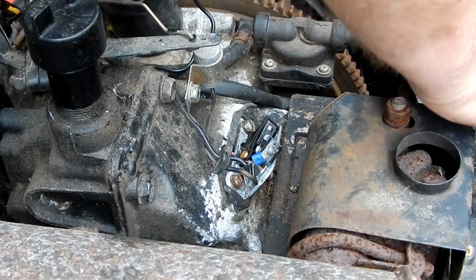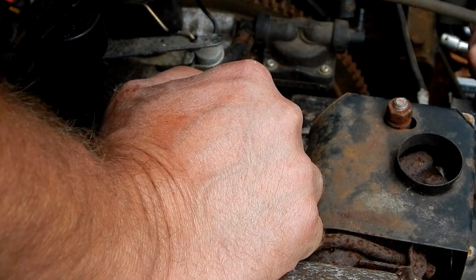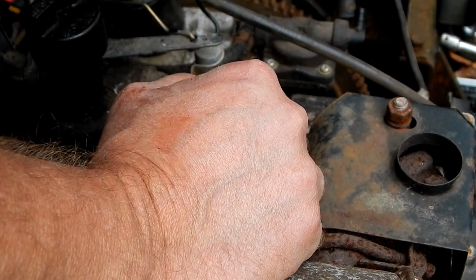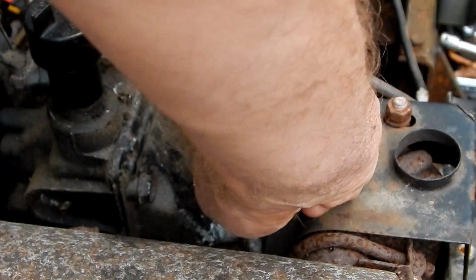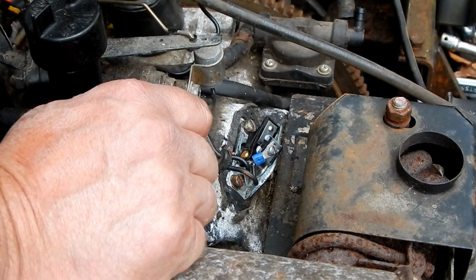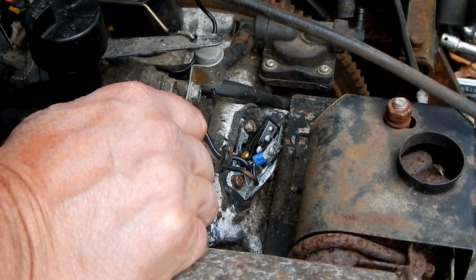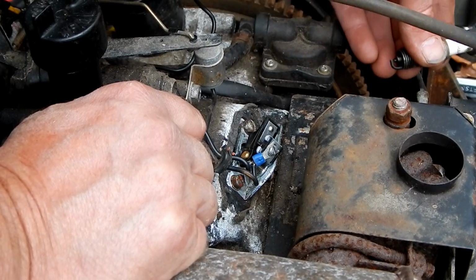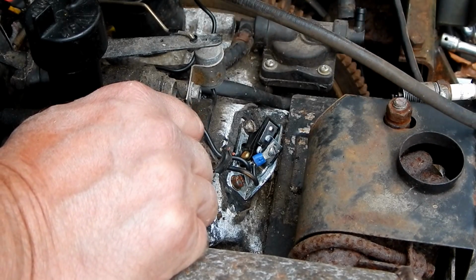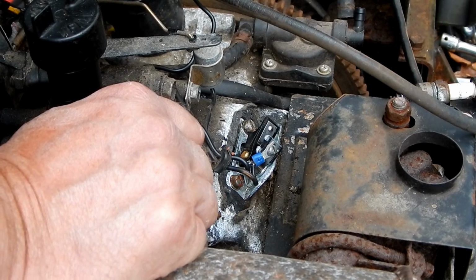You see a spark? Yes. Oh, I couldn't see it from the angle I was looking at. Thought I could hear it. Okay, watch. I'm going to put it this way now that you do it. Oh yeah, okay. We got spark. Shocked me too. If you don't have this grounded well to here, like if you lift this off, then the voltage wants to go somewhere, it'll just go through you. Give you a little, how do you do?